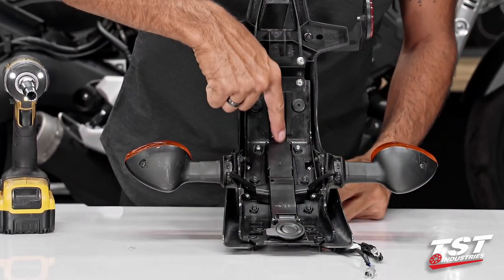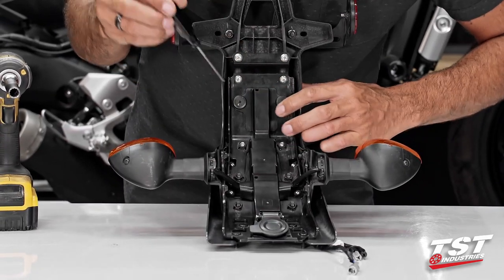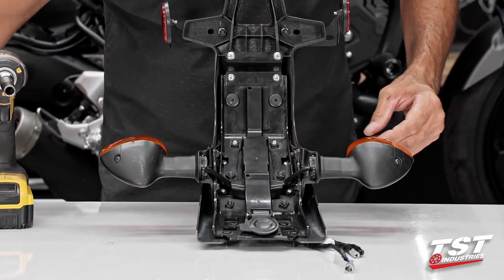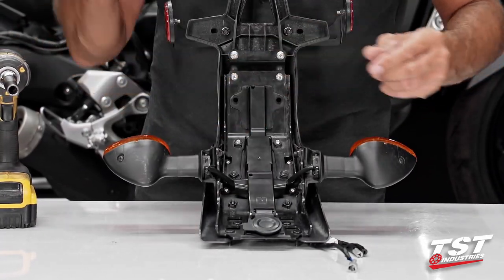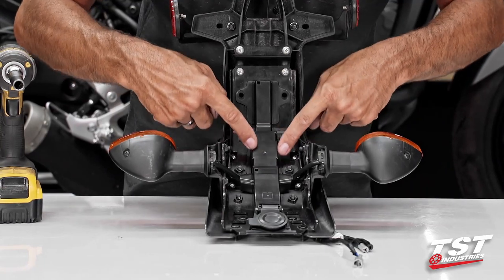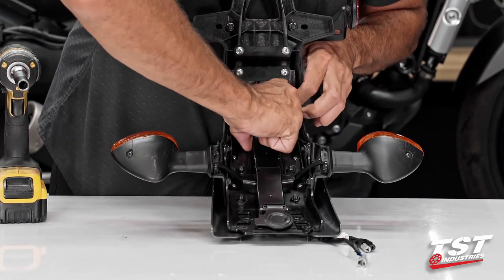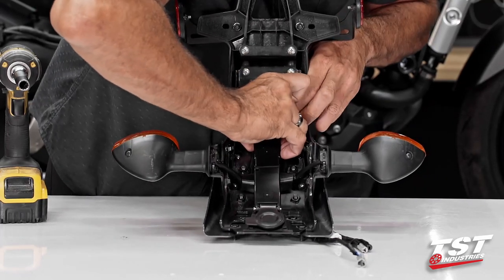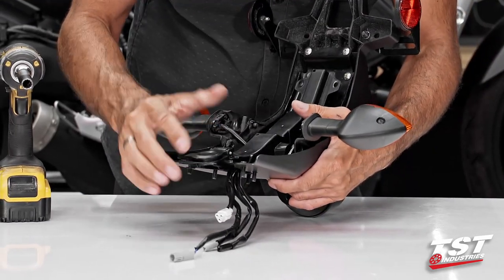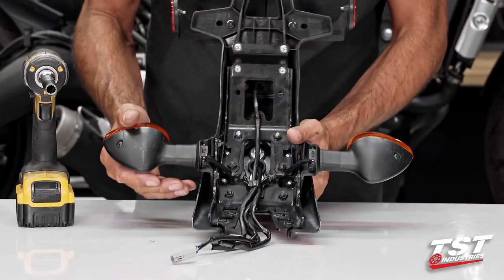We're going to remove this shroud here — you can use a Phillips or a small flathead. These are quarter-turn rivet fasteners. If the entire thing spins, you have to hold the rim and that lets the head pop up. Now you can just pull them out and those go in the bin. You can see there are indentations on the body of this shroud that lead to little clip fasteners. We're going to squeeze that and pop it out. Squeeze them on both sides, clear from the captive window, and this needs to slide towards this edge of the fender. We're going to keep this and now we just continue working.